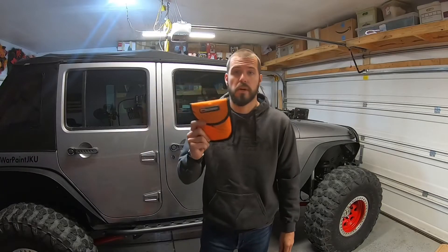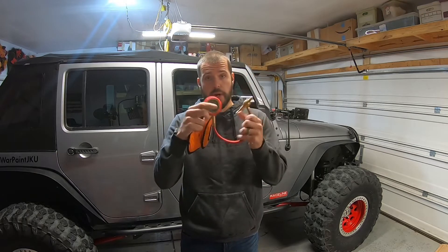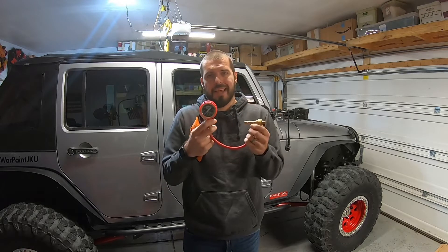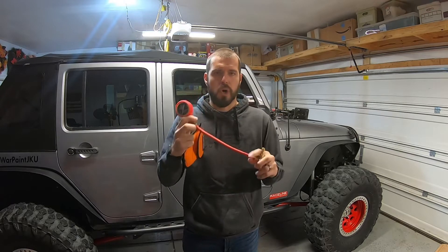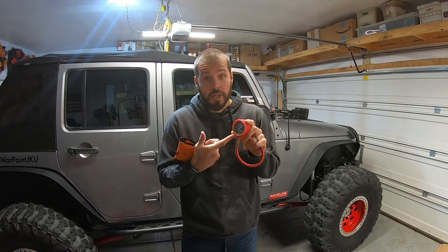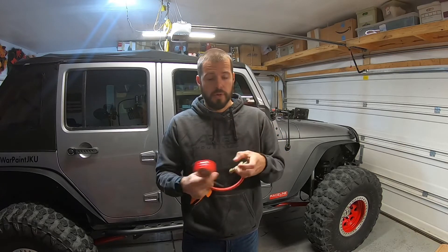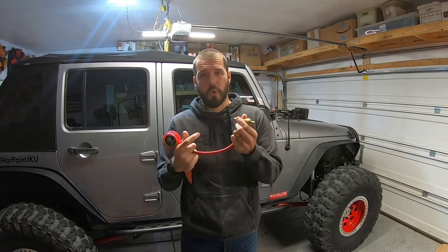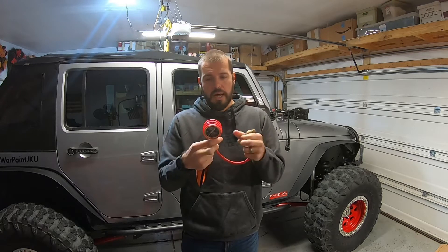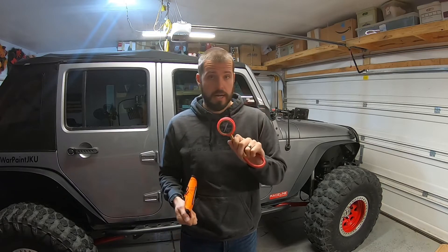This tool right here is made by ARB. It comes in this little pouch, which is pretty cool. There are a lot of different companies that make them, but I like the ARB one — it's made out of higher quality in my experience. It's got a nice braided hose, it's super durable, the gauge is nice and accurate. That's a big thing when you're airing down really low; if you're off by a couple of PSI, that's a big deal. The gauge is accurate, real easy to read, and the tool portion that hooks onto your valve stem is just super high quality.